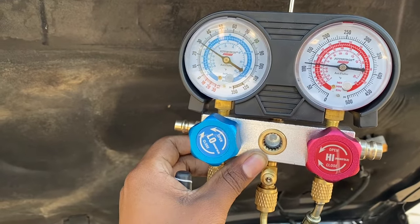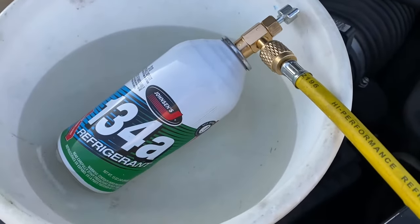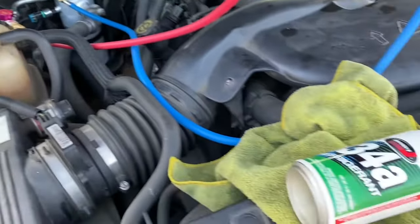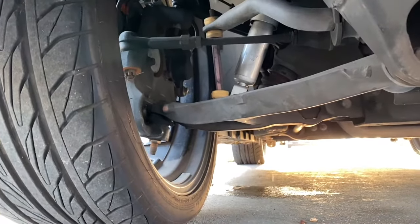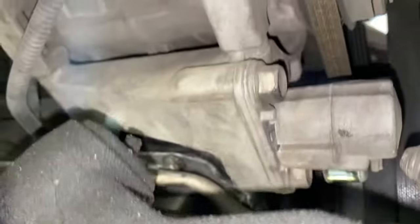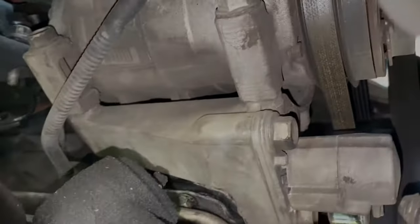I'm not a professional, but I use a bowl of warm water from the sink — not boiling or anything — just to make sure the refrigerant bottle doesn't freeze up like it usually does so it can flow out. It's all going in, the compressor is kicking on. My compressor is definitely going out — I can hear knocking or ticking — so I'll save up and have one on standby, but I wanted to see if that was where the leak was coming from. As you can see, it's dry — no leak. It's been about two weeks and my AC is still blowing cold. If anything else happens I'll update you and make a video on that fix. Thanks for watching.